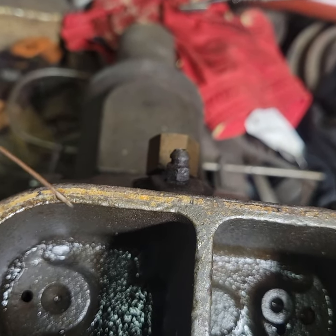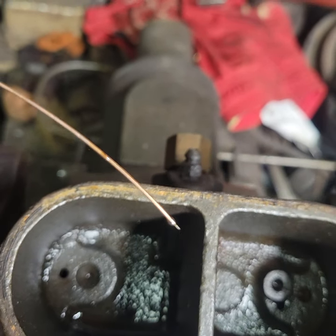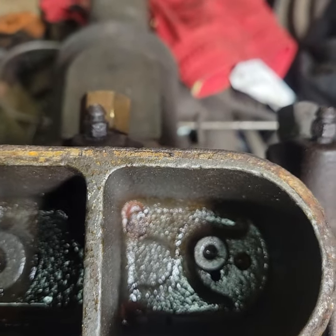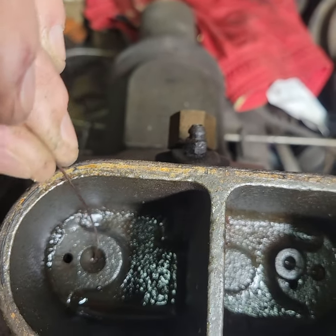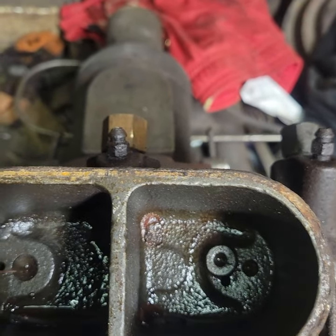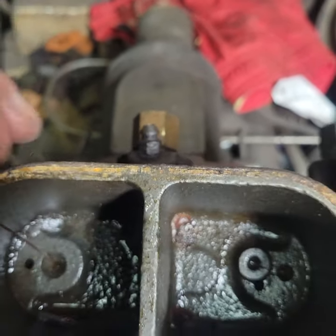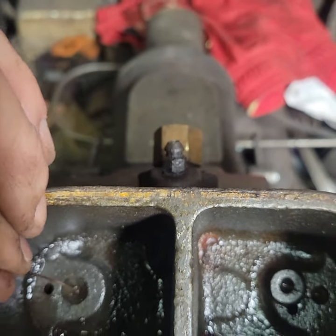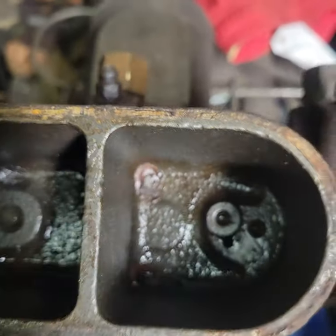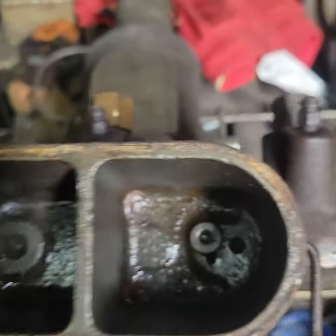After taking it off the grinding wheel, you can see the copper is worn off — this wire is copper coated, not solid copper. I've filed it down to a very fine point, fine enough to go through that tiny compensator valve opening. Moving it in and out ensures the compensator valve is clear of any debris or foreign objects. You can use the other end — with the finer tip — for the regular feed opening. You can see a little bit of debris coming out on the end of the wire as we clear out that compensator.